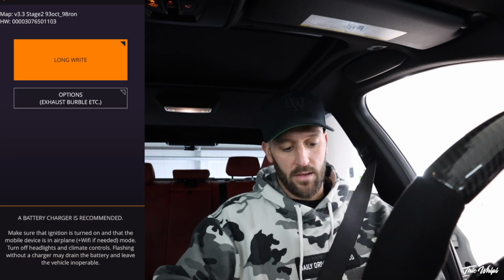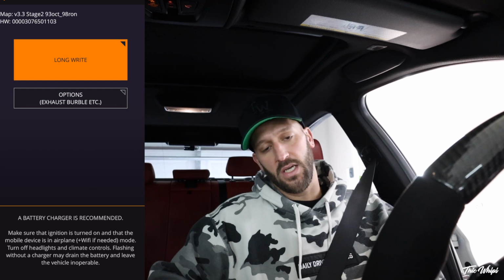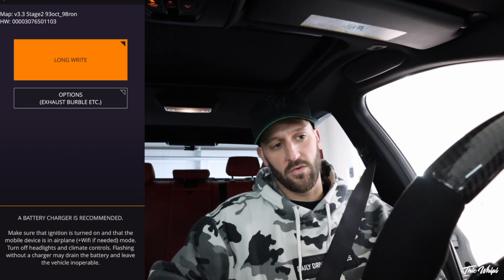We're going to hit back and then we're going to do a long write. Since this is the first time flashing this car with MHD, me personally at least, who knows what the owner did before me, this is going to be a long write. So go ahead and hit it. You see a bunch of errors pop up. This is normal. Let it go through the process. The first time you flash, it's going to take a little bit longer, but in the future, once you've already flashed one map and you're switching maps, it's really, really fast. I think we timed it on the Supra and it was like 8 or 9 seconds. So crazy fast flashing times.